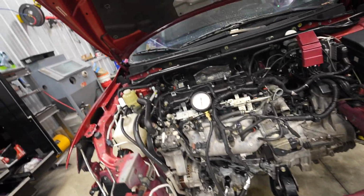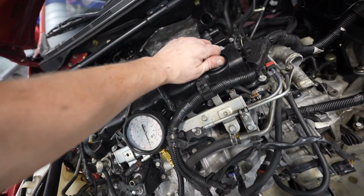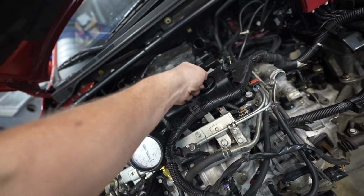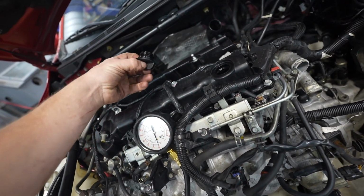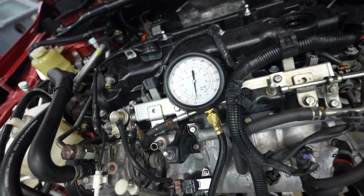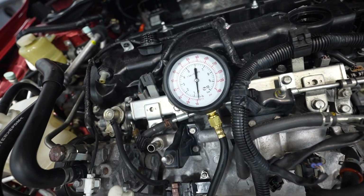We only have a couple little things left to install before we can fire it. Pretty much the radiator with hoses, some coolant, intake, just so we can have the MAF, intercooler with piping, so we don't have a giant air leak, and some engine oil. So right now I'm gonna go ahead and throw engine oil in it. We got this oil pressure gauge on. Oh, and plugs and coils. But right now, let's do the engine oil. And I'm gonna crank it over for a while and start building up some oil pressure. Harbor Freight special has already shown we got a whole 8 PSI.